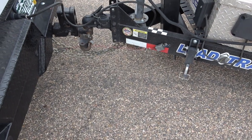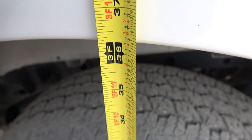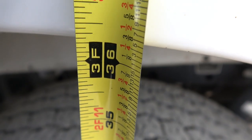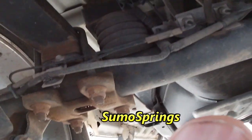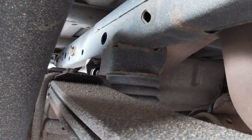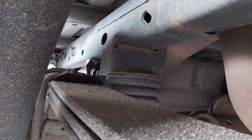For this test, we're going to be using a weight-distributing hitch — actually, a weight-distributing hitch will change the squat, so I want to see true squat without it. The squat with the Sumo Springs looks like 36 and a quarter inches. Here's the first test: testing out the Sumo Springs towing my 8,500-pound trailer with my F-150.